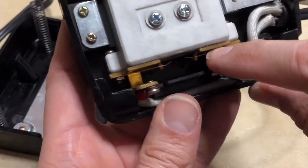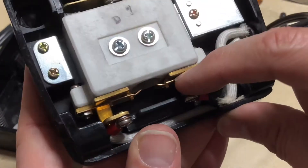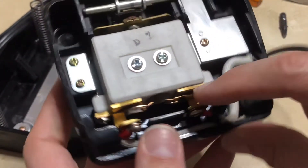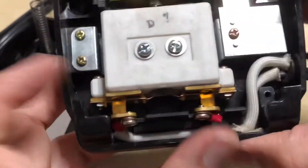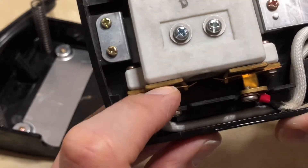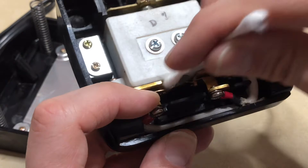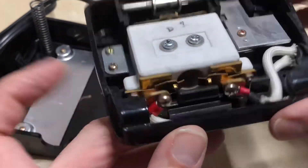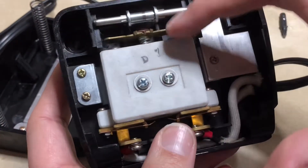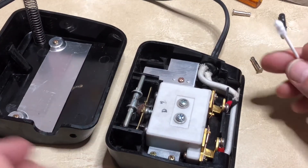You can take your fingernail and pull back the lower contacts — they're spring-loaded, so don't be too hard on it. Pull back just enough and you can get your alcohol cotton swab right back there. Don't put too much pressure on it. There wasn't a lot of residue on this end; it was mostly up top. It is basically clean and ready to go.